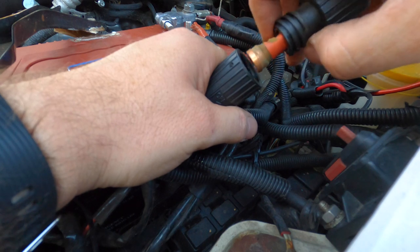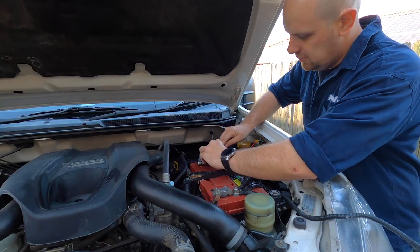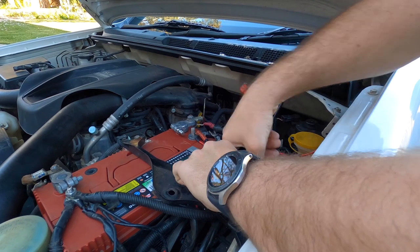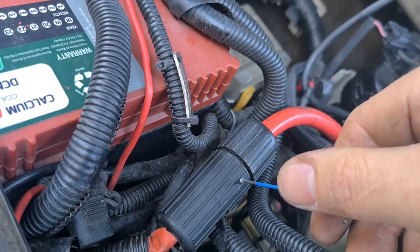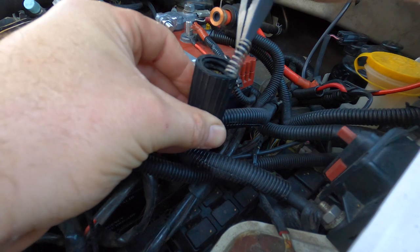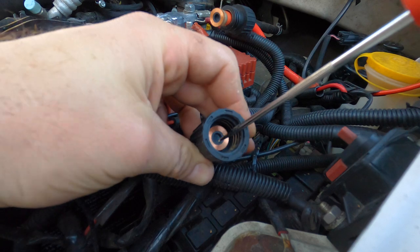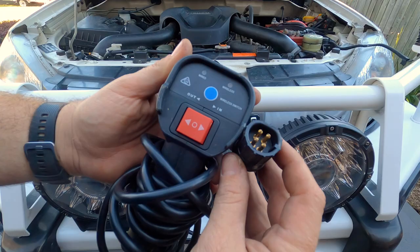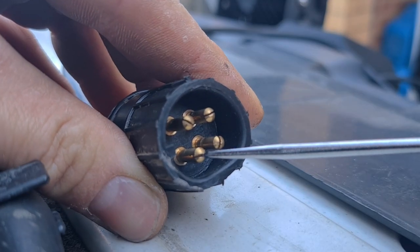The isolator can be removed and cleaned if it doesn't feel like it's engaging properly as you twist. Disconnect the positive lead from the battery and open by unscrewing both ends of the isolator in an anti-clockwise direction. There are also two little grub screws that you need to remove on this isolator. Be careful when separating the two halves to avoid losing the internal spring. Check nothing's built up inside the isolator and that it's making a positive contact when engaged. Next, check for operation of the winch controller — make sure the pins aren't bent or broken, and with a small flat blade screwdriver, very slightly pry them apart.